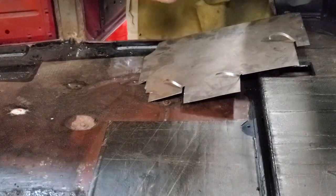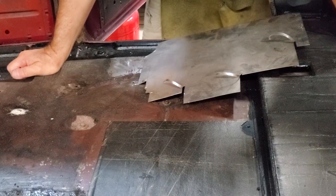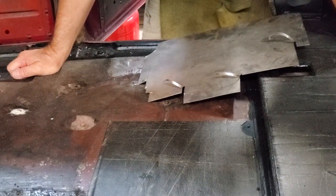There you can see I've welded up one of the holes. Now what we're going to do is get a flap wheel in our grinder and flap-wheel that weld off. If we get a little hole through it, we'll add some more weld and do it again.